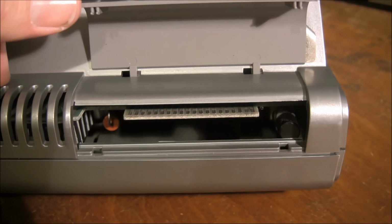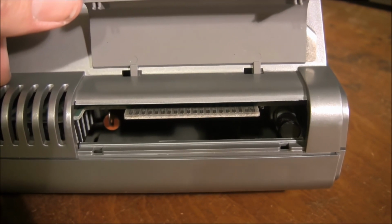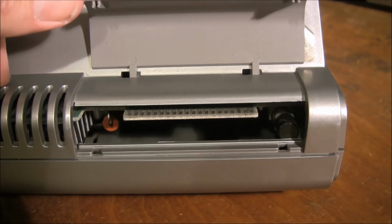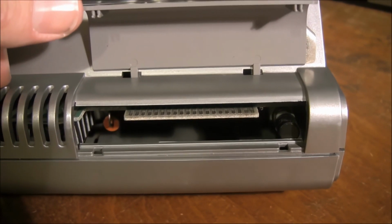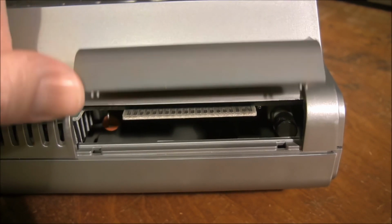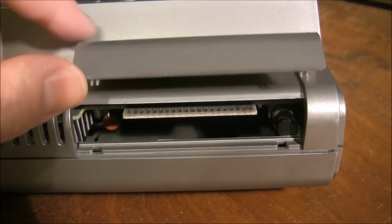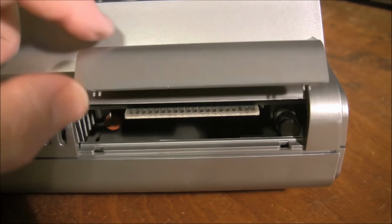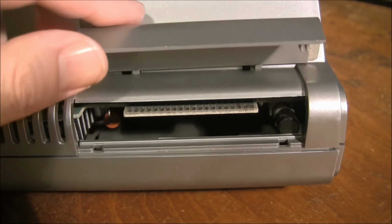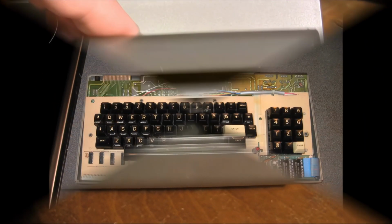It was a real issue, and in fact there were third-party products you could buy, gold-plated card edges that you could solder onto these cheaper card edges to stop that sort of problem happening. It's a problem that wasn't as serious in the Apple II or Commodore PET, because there all of their memory was on the motherboard, rather than accessing part of it through a card edge.